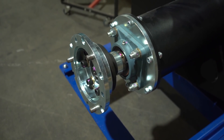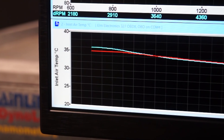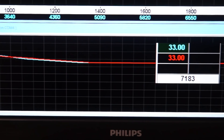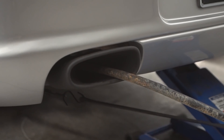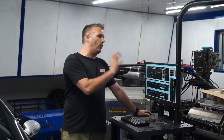We've chosen to use one of their Pro Hub dynos. Firstly, it's super consistent — there's no wheel spin, no variation in tyres getting hot, or strapping the car down. Secondly, we can plug into the OBD2 port and read intake air temperature, timing, and air fuel ratio. So as we do the tests, we can ensure consistent intake air temps for each comparison and understand the reasons behind any power gains or losses.